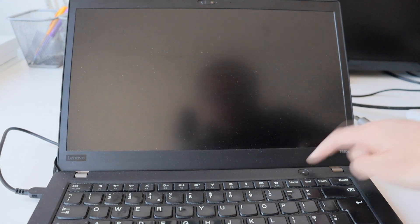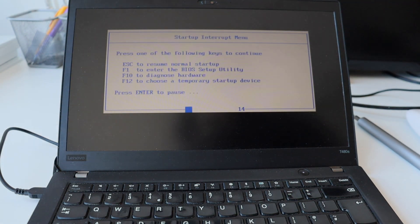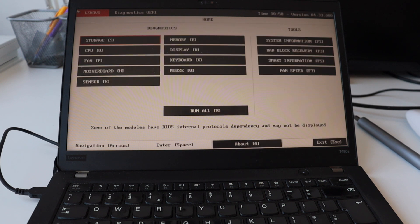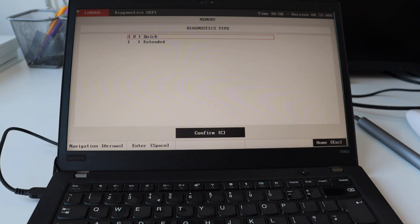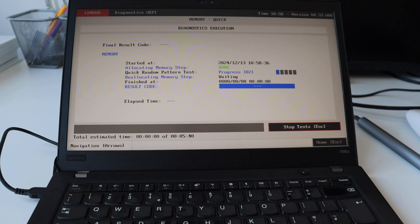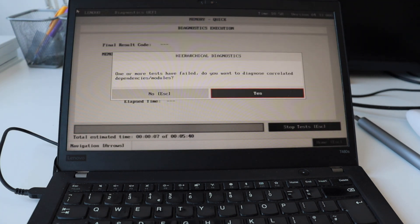Thanks to the magic of video editing, we can fast forward and quickly see how I reassemble the back cover. Now it's time to try out the upgrade. It's very important to plug in a USB charger — this will re-enable the built-in battery. Turn on the computer, quickly hit Enter, and from the menu press F10 to diagnose the hardware. This tool is amazing — it's a key feature for Lenovo ThinkPad laptops that I really love and highly recommend, and one of the key differences between ThinkPads and other laptops. We're interested in testing the new memory I've just installed. Please note that this Lenovo diagnostics tool is part of the firmware, so it runs the same way regardless of whether you have an operating system or what kind of OS you have. It's a low-level tool for testing the hardware.